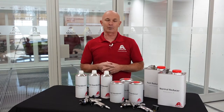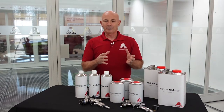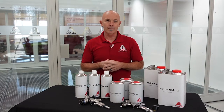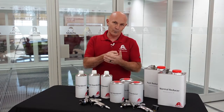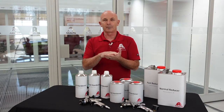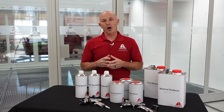Slower reducers will almost always give us better metallic control as well. So if you're in between a temperature range, you always want to lean towards the slower side. When you spray something that's drying a little bit slower, the application is so much nicer — it'll hit the panel, roll over, relax, and give you a real smooth, flat surface. If we're spraying with a solvent that's drying too fast, we're more than likely going to over-apply the material, trap solvents, cause the surface to skin over, and end up with fuzziness, dieback, and maybe even solvent pop later on.